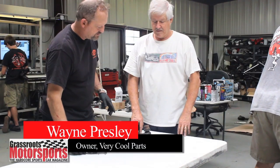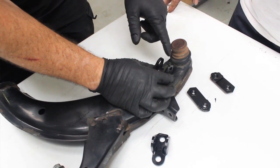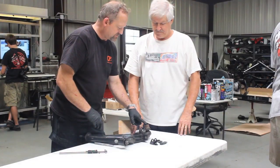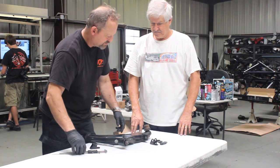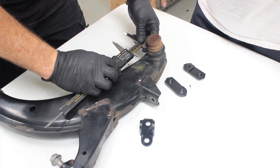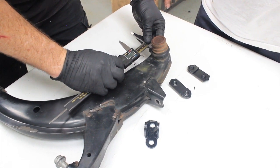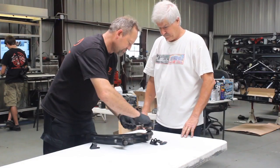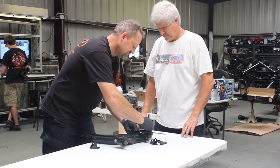What we're going to be doing is putting these shock mounts on the control arms. What we're going to do is locate a hole off of the center of the ball joint and the back edge of the control arm. We're going to come one and a quarter inches off the back edge and put in a 10mm hole.